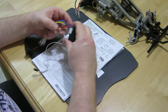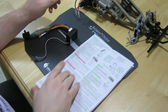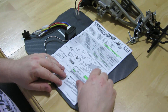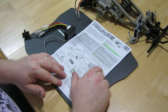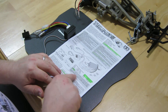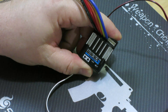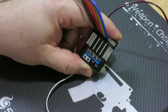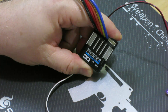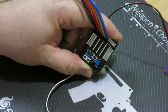That's the information about the speed control. Know that if you do plan to use a brushless motor, you will need to purchase the extra sensor cable in addition to the motor, and possibly a cooling fan. The ESC comes configured from the factory in brushless mode, which doesn't match your brushed motor. You can tell this because if you just turn it on, the LED will blink orange, telling you it's configured to brushless mode.